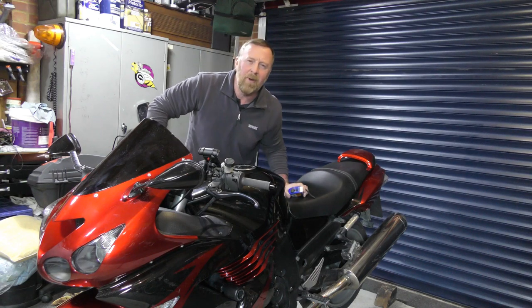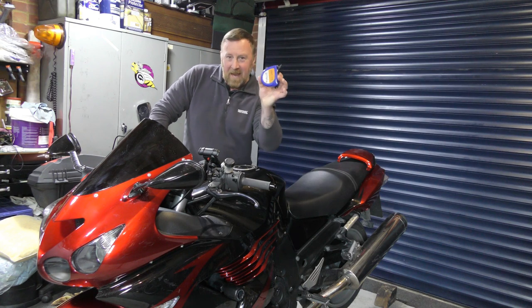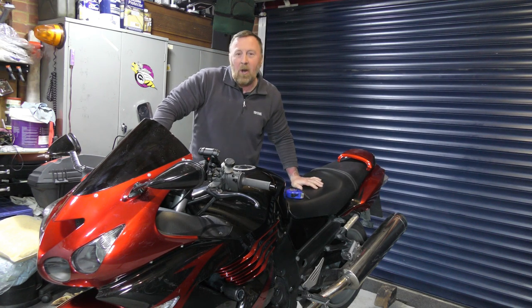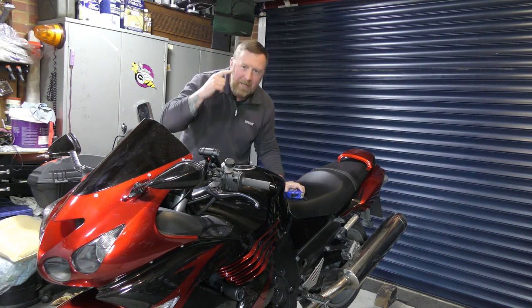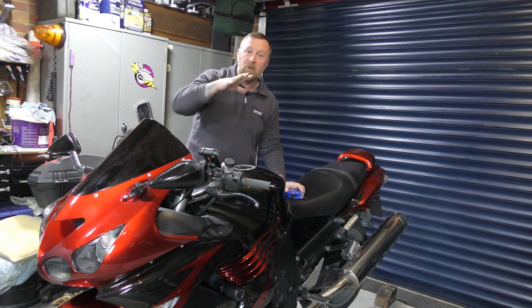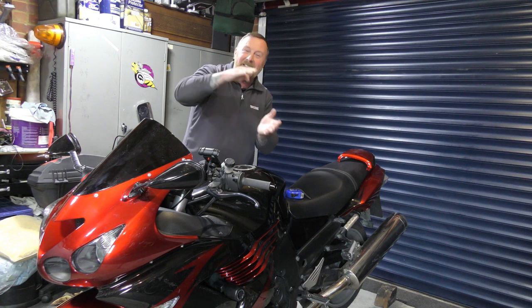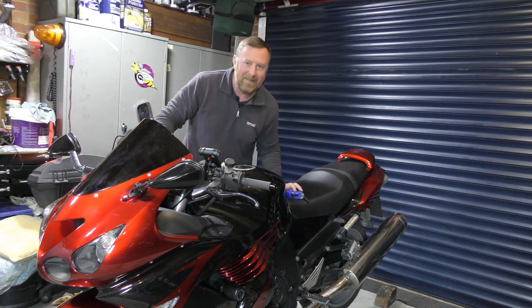I'm Mark Sarge here, welcome to my channel ZZR time. Tape measure in my hand - this bike has been lowered. Oddly enough, the suspension arms are longer than you'd think. When you shorten the suspension to go lower, you'd think it gets smaller, but they actually extend, which makes the suspension go further down, bringing the wheel up. That's how it works.